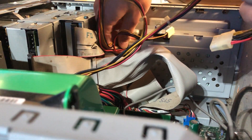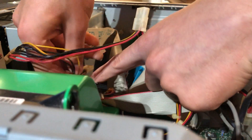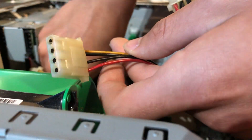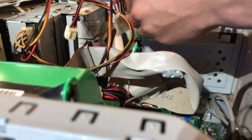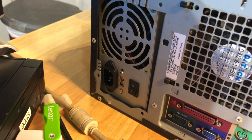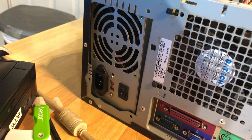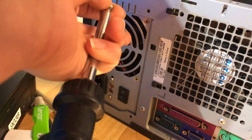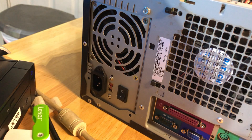This is a new drive in here because I believe the original hard drive was dying. I'm going to insert all this stuff in here, screw it down, cross our fingers and it boots. Everything should be in. There's another Dell over here — it's the workbench PC. I have a modern one back here too to download PDFs, instruction manuals and things. I don't think we've ever looked behind this thing to see if the power supply fan was running. It might have probably ran like that for a long time — and indeed it was not running, so we're going to go ahead and replace it.